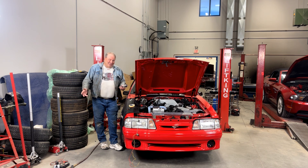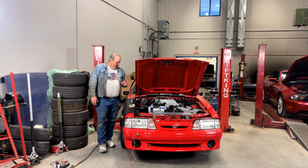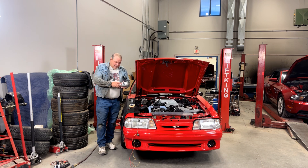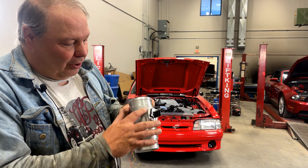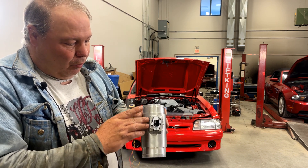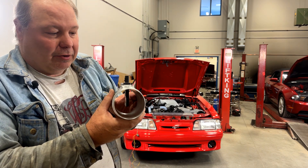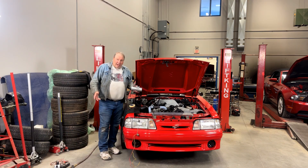This meter blew up and it's about four weeks to get another one. This car needs to get moved along, so our next closest setup was to install one of these SCT BA5000 slot MAFs in the original three inch Pro-Tube. That's been done with a weld-on conversion kit — there's an aluminum boss here which was welded in place and then the slot MAF was put in. You can get a closer look at the slot MAF here.